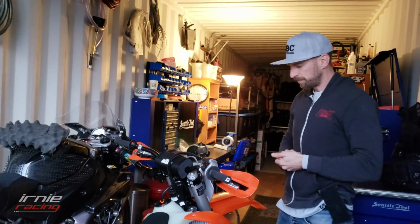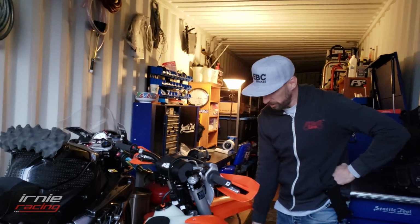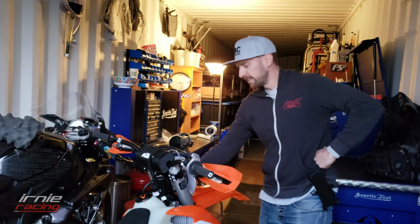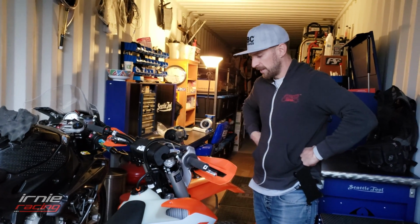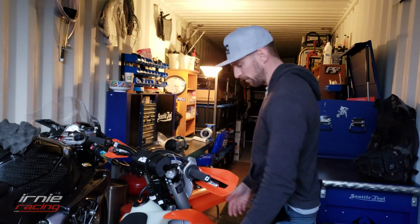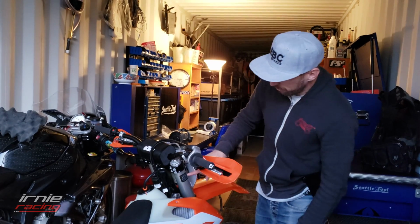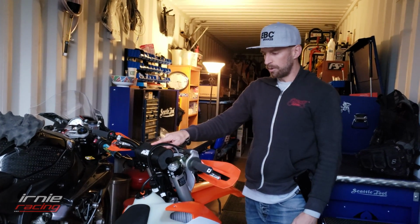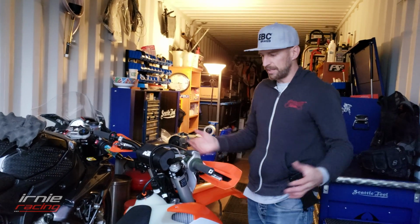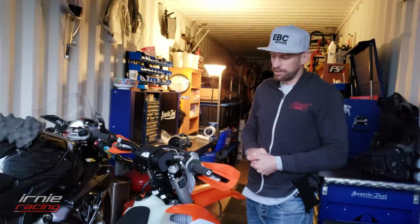So now there's no fluid in the forks then, just air? No, there's definitely fluid. One fork is all your damping and oil. There's just no spring in there. Gotcha. And then the other side is the air chambers. I didn't adjust anything. It's still on whatever it was. The sticker said 12 compression, 12 rebound, and we're running 9 bar. Because I'm not doing too many jumps, I could even lower the bar to make it a little softer. Right now I'm at 130 PSI. I think 132, bring it down.